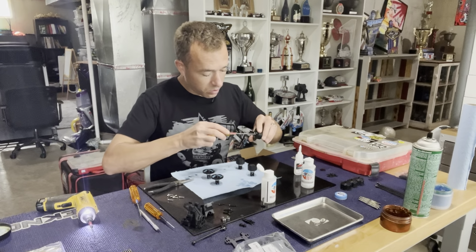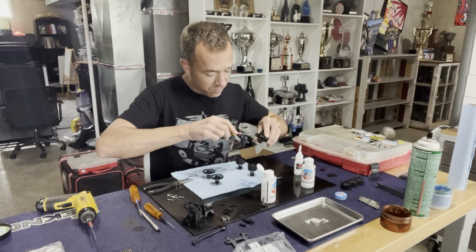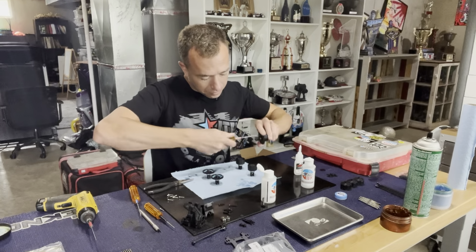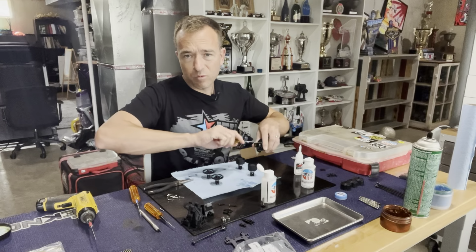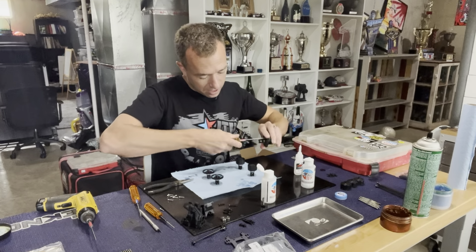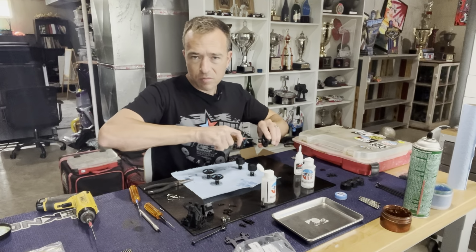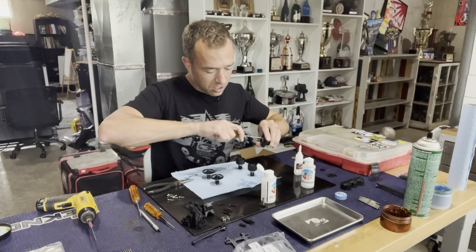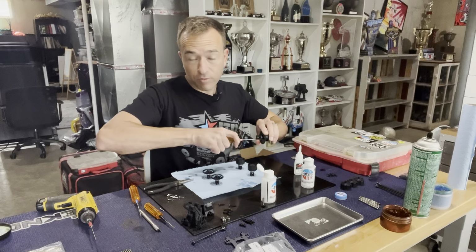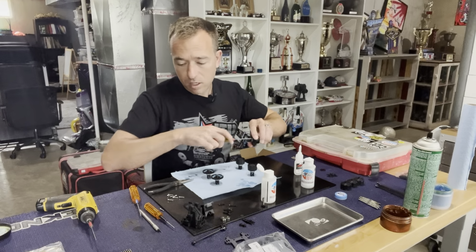One thing to note as well, when you're building a fresh car, you have fresh diff gears inside the diff, and then with a fresh gasket, you just run it a little bit, and then go ahead, open them up, put fresh oil in there, and then kind of reseal it up. I feel like new gaskets leak sometimes, just because they need to get kind of smashed down a little bit. And then with new diff gears internal, you'll want to have just a little bit of a break-in period.